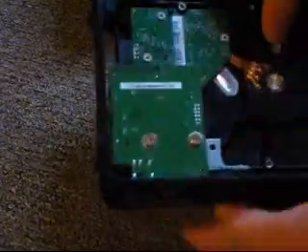It's something to be aware of. I'm not sure what direction you're supposed to do this, but just go ahead and sort of push on it a little bit — gently, of course, so that you don't accidentally break anything. There. And then you've got these little rubber pieces in there. Now that the actual hard drive is out of this little mount, we can go ahead and begin unscrewing these screws here.